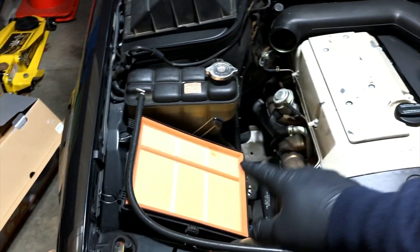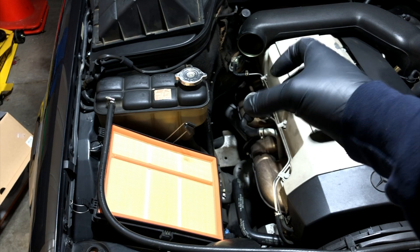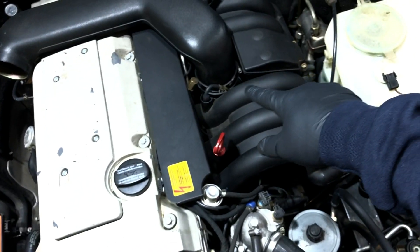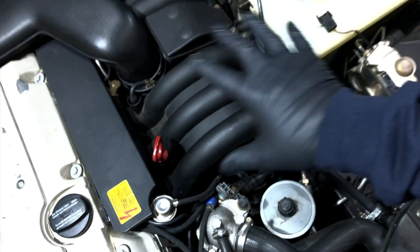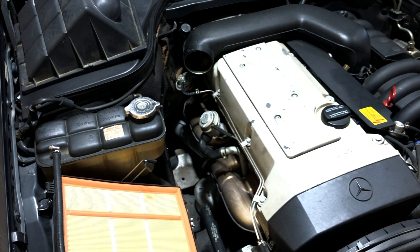I hooked up my bladder — my little pressure bladder that's going to expand. I also removed my air intake cover, my mass airflow sensor, and the flexible hose. I'm going to put that bladder right inside that hole over there, because that's going to be the most direct entry point. I want to test if I have any air leaks. I had replaced this gasket — or this bushing, this baffle — that connects to the throttle body. It was really tough to screw tight, so I'm curious if there's a leak there, and also just generally vacuum lines everywhere else.